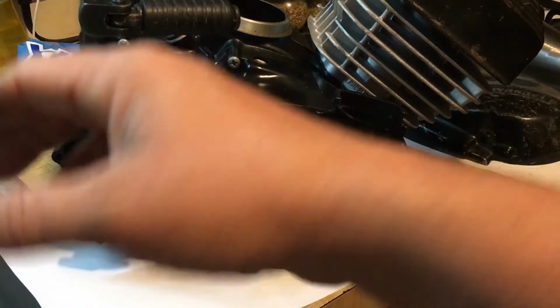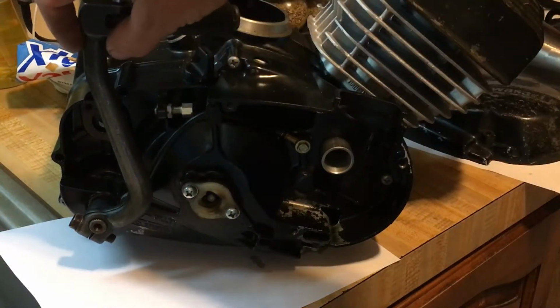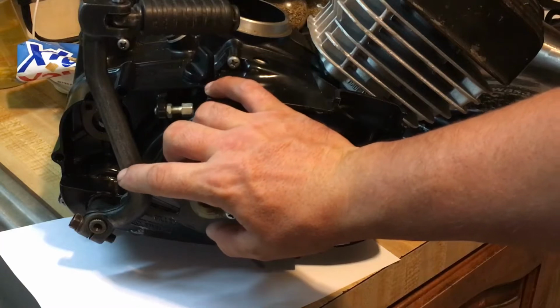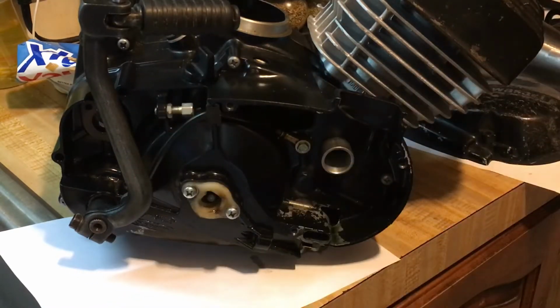And then I'll chamfer them. I'm just making them so they look not just drilled holes. You know what I mean? You want to make sure you get them in a drill press because you want it to look nice. Right here it comes straight down to here, then it bends here and then it goes here. So from right here to right here, probably put 3 to 5 holes right in this region right here.